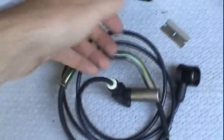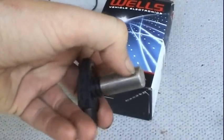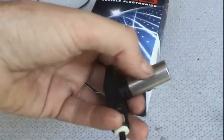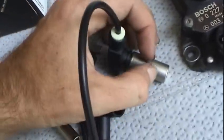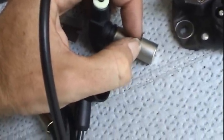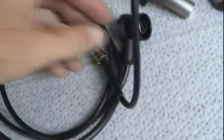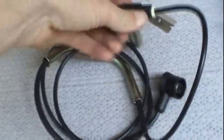So just like with ignition coils, because they're constructed in very much the same manner, we've got very fine insulated wire in here wrapped tightly around a ferrite core. Over time, the expansion and contraction along with the heat has probably degraded the insulation in here, and there's probably a certain point along this coil where you've got two pieces of wire that are separating, and as the temperature gets hotter, it expands and those wires pull apart and you get that high resistance. So without taking the thing apart, which is not really serviceable, that's going to be my going theory there.